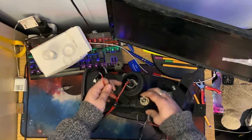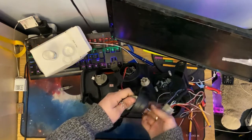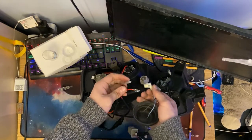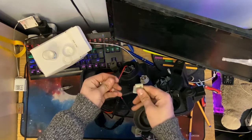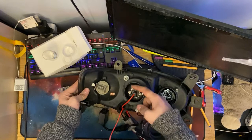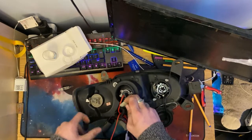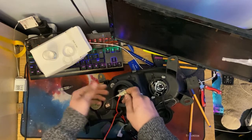And then these would take from your original car loom on this bung here, and then you'd originally plug them, you know, positive to positive, negative to negative, and you'd have to unplug the ground wire off the actual socket if it's an H1 fitment, because it grounds through the socket. So you'd unplug that off the socket and then plug that into like so.